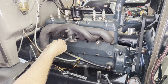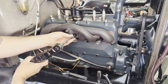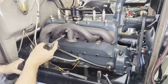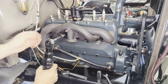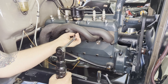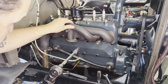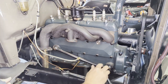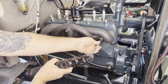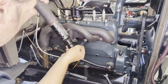I've got a half inch socket so I can remove these with my trusty Harbor Freight electric ratchet, which always works great. Both of those removed. I'm assuming that's going to let me separate the intake manifold from the exhaust manifold — we'll find out. Now I'm going to get these loosened up.